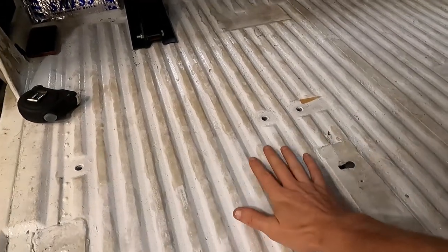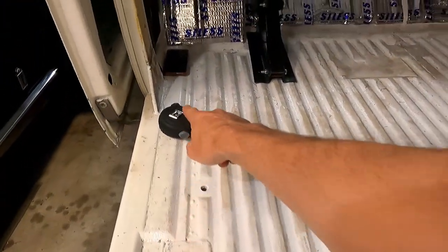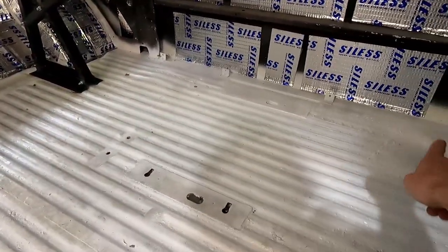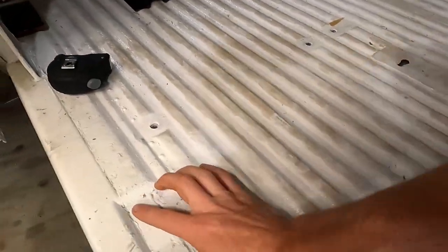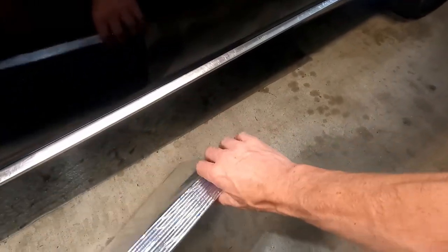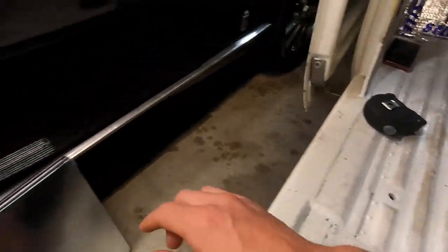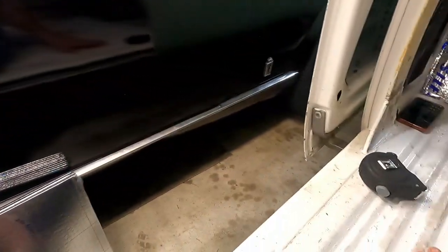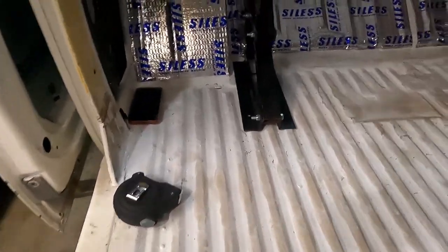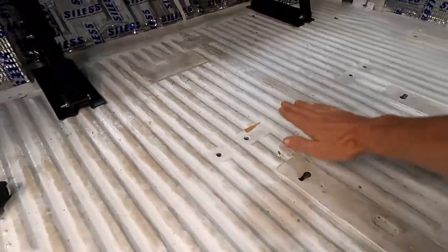So our floor has this rib pattern just for structure, so it's not just a big flat piece, but it's also got these edges here all the way around the outside, across the back, even here in the middle of it, solid. You come across the front here, and this kind of shape all the way up to our vents are back here. So what we have to do is use this underlayment right here to make up a little bit of this gap. It'll also bridge the gap between all of these. And then the vinyl plank on top of that should go all the way across. That's kind of my thought behind that. So it'll end up being flat level from here all the way across to the other side.